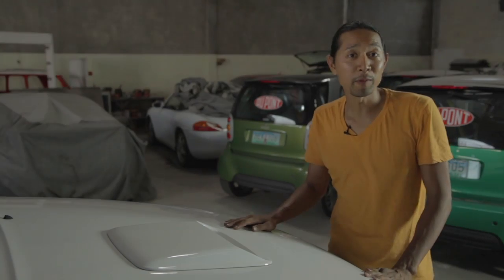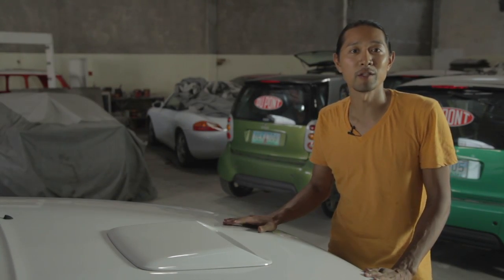After all that, you want to test your brakes in the shop before actually getting on the road. Make sure you have good pedal feel — if it feels mushy or like you have a deep brake, you better check your work again. When bedding in your new brakes and pads, bed them nice and evenly. I like to do the Stop Tech method: run from 120 to 40 with deep even braking, doing this about 8 to 12 times, then let the rotors cool while rolling before stopping. This helps make sure the pads and rotors bed evenly.